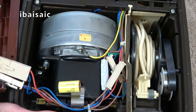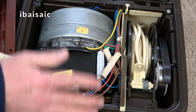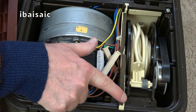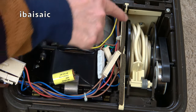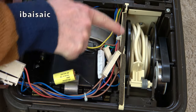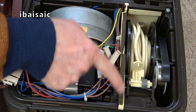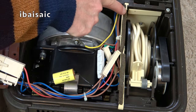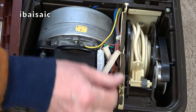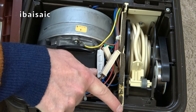It's very, very clean in there - and I don't think it's clean because it's been refurbished, I think it's clean because it just hasn't had very much use. The motor certainly sounds fine. The flex rewind partition between the cord rewind and the motor has perished - but just a bit of old fashioned draft excluder foam for windows, trimmed to size, would work. Clean all the old stuff off with sticky stuff remover, then put a new piece over it.